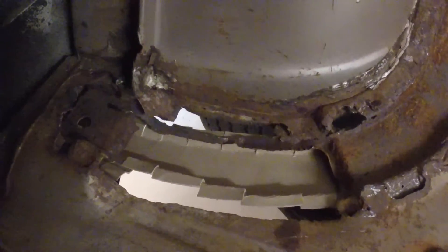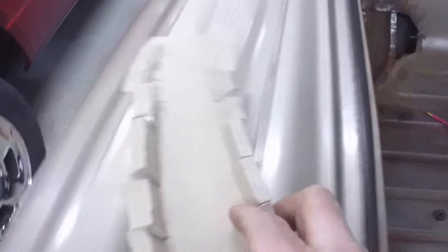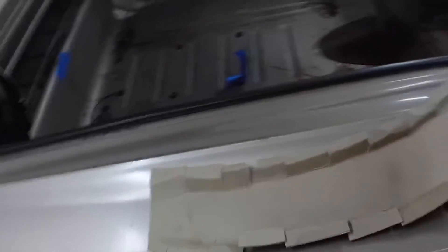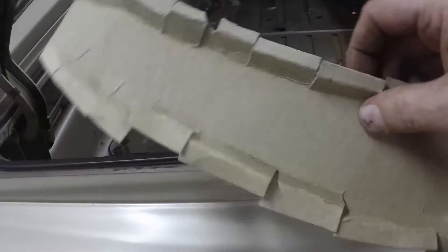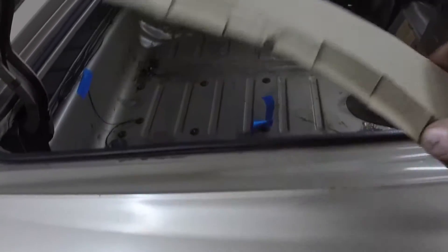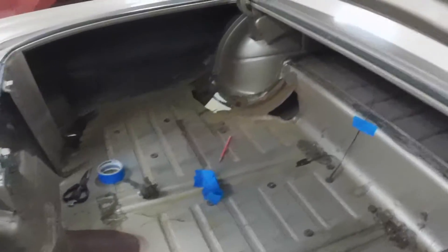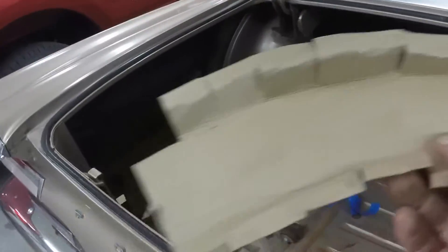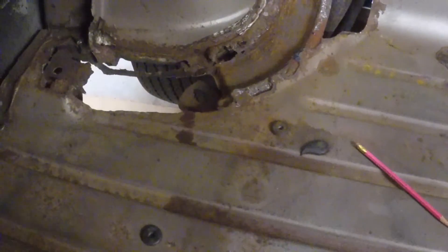This video may be a little out of order. I just wanted to do a little video of how I make this brace. I make it out of cardboard, basically get it to fit. What I do is I straighten it out on the sheet metal — trace it out. I'll make the whole piece to where it fits where it's supposed to, then weld all these cuts up and grind them so it looks like one piece, then weld it into the car after it's all made. Then I'll make the sheet metal panels and weld the whole thing up. To save myself some work, I traced this before I did any cutting onto another piece of cardboard — then I can just add on to it to do the rest and make all the little bits that will make it look right.